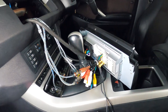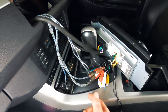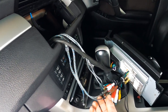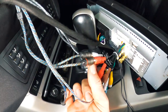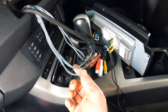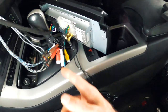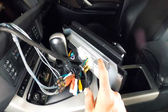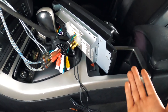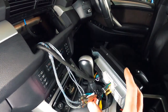Quick update — I've got the main six meter cable plugged into the head unit and I've got three sets of RCAs: two for the front channel, two rear channel ones which are the red and white, and then one channel going to the subwoofer. I'd like to split the sub signal so it's got two wires going back but I don't have the adapters. The RCA outputs on these Android head units are pretty weak — about 0.7 volt output, compared to like a 4 volt pre-out on a good Alpine or aftermarket head unit. They're mediocre but will do the job. That is ready to slot into its hole.